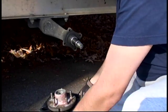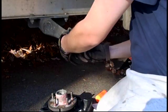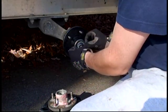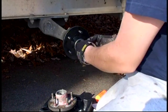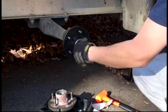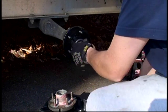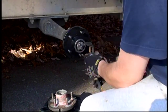Everything looks good. We're going to go into our Smith kit and pop out our pre-packed hub kit, ready to go. It should go on nice and easy. See all the nice fresh grease — everything's packed in there. Go ahead and put our washer back on. Find a flat spot, get that on there, push it in good. Get our castle nut, snug it up as far as we can by hand, then we'll get our channel locks. We're going to go slow with this so we can feel it snug up and tighten up the hub.